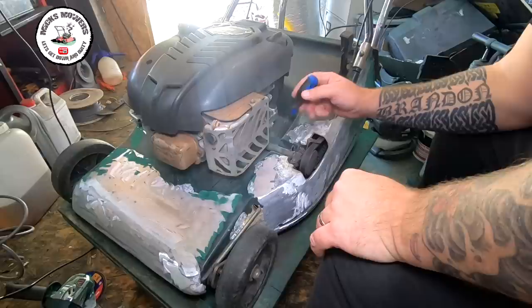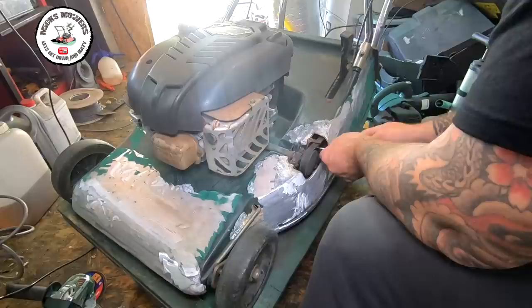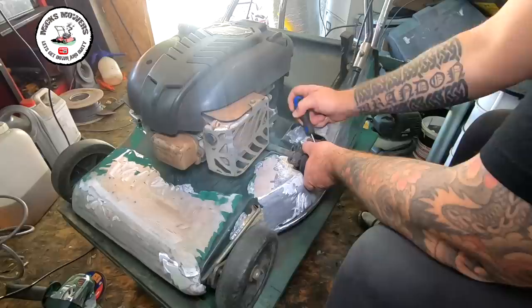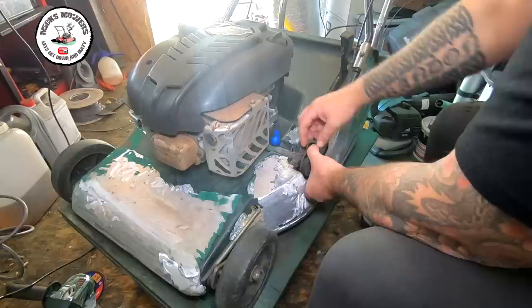The first thing we need to do is take this belt off. There are two little tiny 10mm bolts, one here and one here. That must come off because it will allow you to take the shaft off with the engine rather than taking the shaft pin off — so you can literally just take this whole pulley assembly off. Simply lift the belt up, get it past that little tiny tensioner and then bring it back over, attacking it from all angles. Tease it on over off the pulley. Bear in mind this is a brand new belt, so go a little bit easier with it — you don't want to be stretching it to the max.